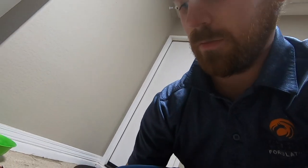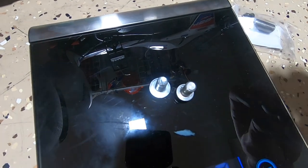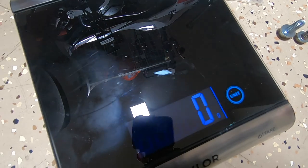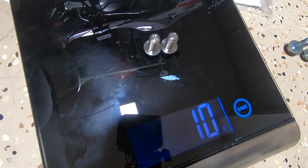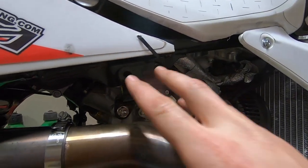Next up are the motor mount bolts - these aren't OEM motor mount bolts but we'll weigh them anyway. The stock ones for the top weigh 18 grams; the titanium replacements weigh 8 grams - about 50% lighter, better than the 40% the 4Works website claims. It's an easy job - just these two holes here and the two on the other side. These bolts are about 30 bucks for four of them, not cheap but a cool bling factor.